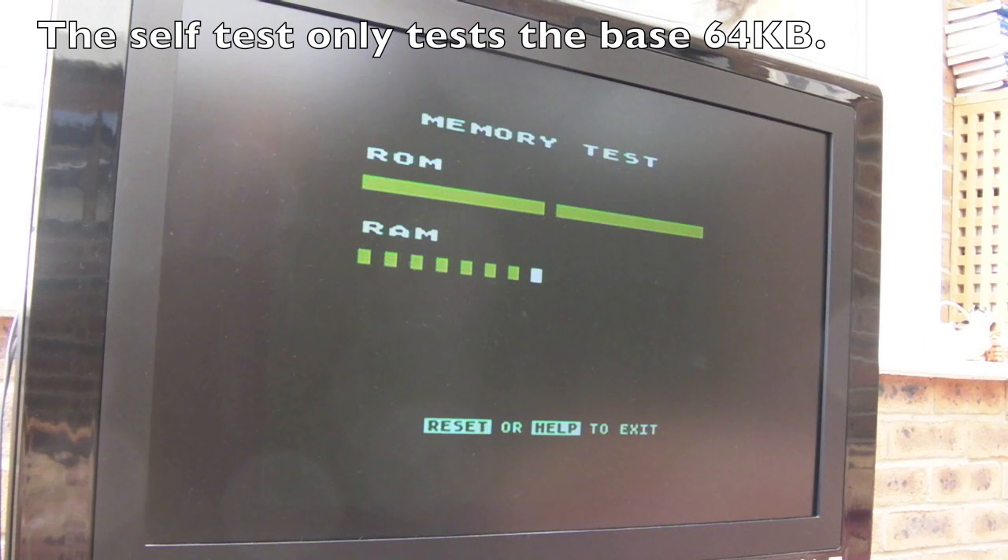It booted straight away without that additional 4164 DRAM — that's a good sign. I've gone straight into the self-test by holding the Option key on from a cold power-up. I'll just let it go through the RAM test. I'm curious whether we get any indication — whether that RAM test is only going to test 64K, or will it detect that it should have 128K because I've added the Atari EMMU chip, and will we see some failures halfway through? I'm hoping we do see failures because it's a good way of being able to test this before and after I've added the RAM. I've been looking for something to test 4164 chips for a while.